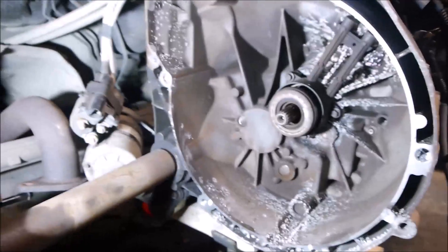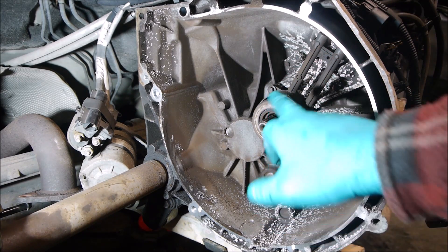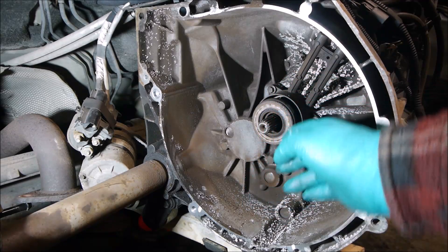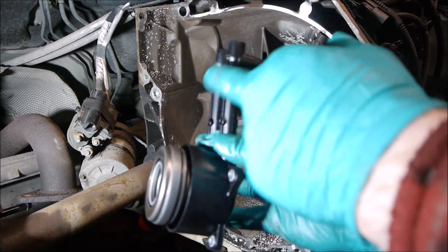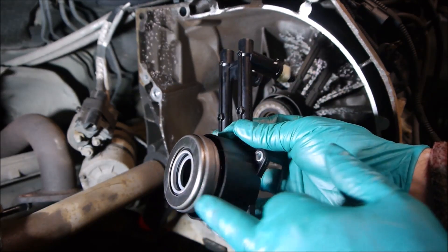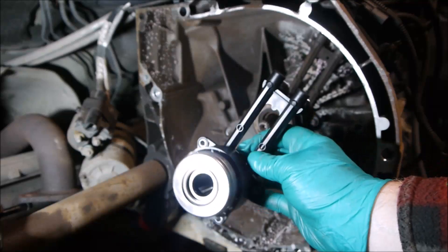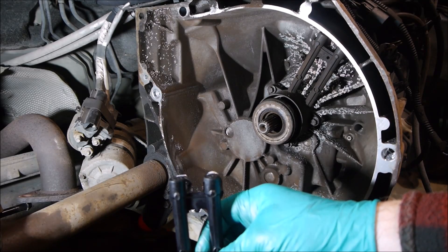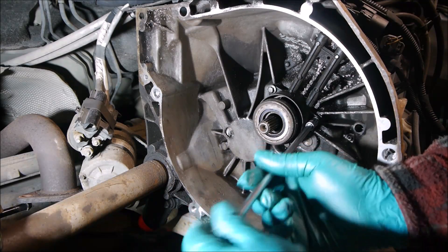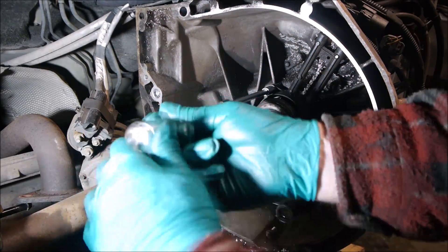While we've got the engine out, we're going to put a new clutch in. Part of this new clutch is a new slave cylinder. On an older car this would have just been the release bearing on a fork, but now it's basically all in one - hydraulic fluid comes down here and pushes this in and out. It's your release bearing and slave cylinder all in one. This whole cassette is going to be replaced on a quick-release pipe - there is some improvement, we've got to give them that.